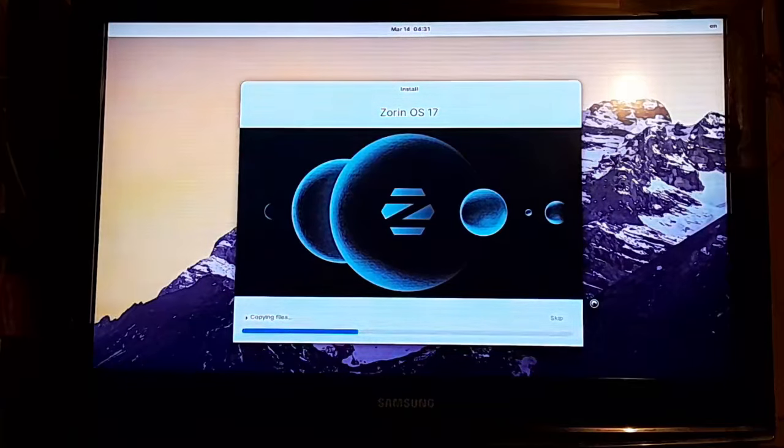It really does after a while, and it'll make it a lot easier when I want to back up the partitions, because I can just do a backup of each OS as a separate image. Normally if you back up an image of an operating system, it copies the boot record, and you don't want the boot record with two OSs on there, because it's a bit messy. Anyway, pausing again, because it's taking a while.